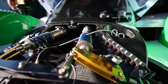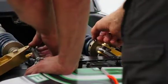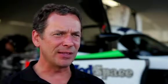There are so many rules of thumb which work within a range, but there's always the caveat — this is what you do until you don't. It's never simple. The car's oversteering so I'm going to soften the rear sway bar — but if you just do that and assume that's what's going to make it great for the race, you go out and find that's the one time where that doesn't work.